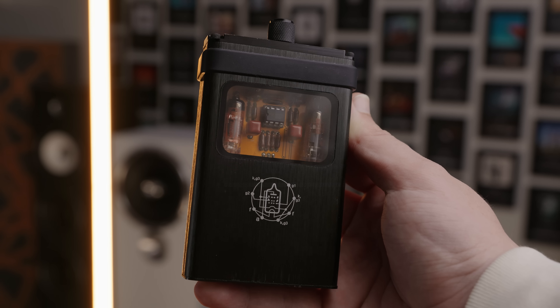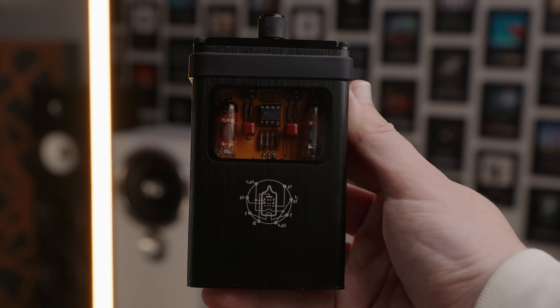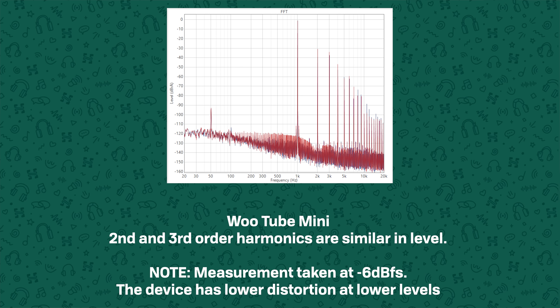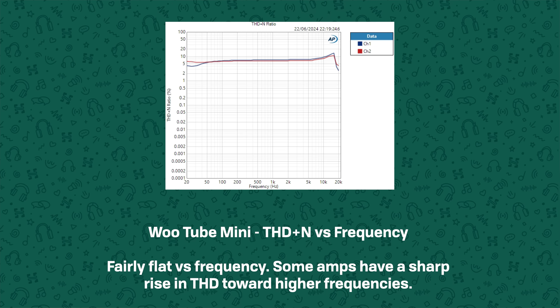The Little Bear does exactly what I mentioned a moment ago — it goes way too far into that warm and stereotypically tube-y sort of sound and just ends up being muddy. For busier tracks like 'Pain' by The War on Drugs you can't really focus on one particular element once lots of stuff is playing at once, and for tracks with more high frequency content and airiness to them, it doesn't really have the same sense of space. 'Best Behaviour' by Mansion Air is a good example. On the Little Bear the vocals sound lovely — warm and lush — but the sense of space and air and environment is not really there. Whereas you swap back to the Tube Mini and it just kind of feels like the music can breathe openly again. This could potentially be explained by the harmonic distortion profile. Most tube amplifiers will have a very heavily second-order dominant distortion profile, whereas the Tube Mini actually has almost the same level of third-order harmonics as it does second-order for higher level signals, which tends to balance out that warmth with a little bit more bite. It also has a fairly flat distortion profile versus frequency, so you don't get a rise into the high frequencies that can sometimes make things sound softer.